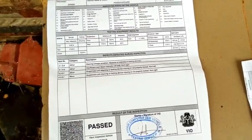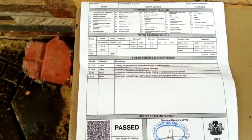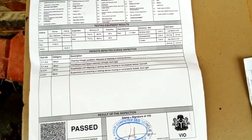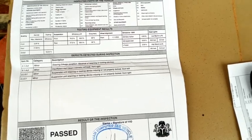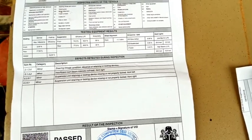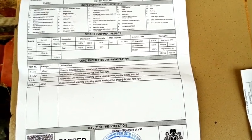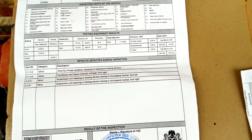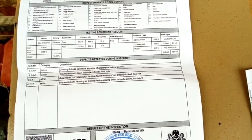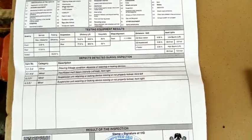One final piece of advice is that if you're going to change your rear brake shoes, it's recommended you change your return springs. In addition to that, I would say just change out those wheel cylinders. They are not expensive and will save you the hassle of going back to your brakes to undo the whole thing and change wheel cylinders. I think it's better if you change out the pads or shoes in this case: change the return springs, change the wheel cylinder, that way everything is new and you're good for another couple of tens of thousands of miles. I think that's better in my opinion.